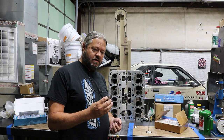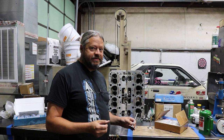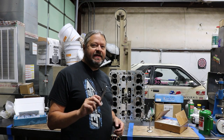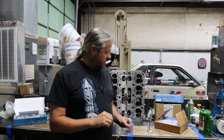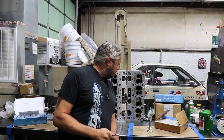This has got like a two-inch intake valve in it, which is weird. So we're going to put a slightly bigger 2.05-inch valve in here, assuming the seat's going to be big enough. And at the same time, we're going to valve job the exhaust as well. I'm going to change the exhaust valve seating angle — not the exhaust valve angle, but the seating angle. That's the angle the valve sits on when it closes, which is the sealing portion of the valve. The stock form is 45 degrees, and I'm going to take it to 55. I do that on a lot of stuff and it really helps flow and power.